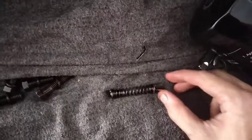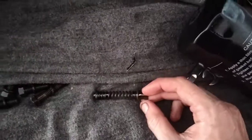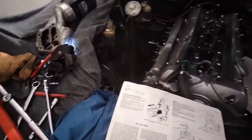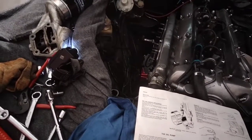This is the oil pressure relief valve on a Jag 420 — I believe this is the same for early XJ6s as well. The symptoms I had were: start the car, let it go to 45 psi when it's cold, and then fairly quickly as the car would heat up, it would come back to near zero.